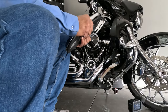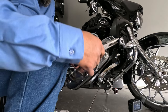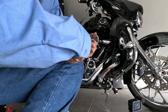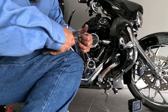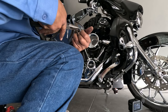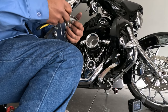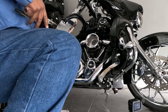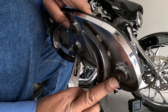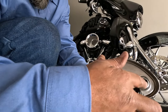Now I want to show y'all how I'm going to do it — I got some needle nose pliers. What I'm doing is shoving it in and then grabbing the rubber and just pulling. I can tell somebody's already had these off before because part of it's already been ripped off. So just work your way around — a little tedious and time consuming but you'll get it. That's what it looks like when you get it back through. Got them all pulled back through — you got four of them, like I said just work your way around.